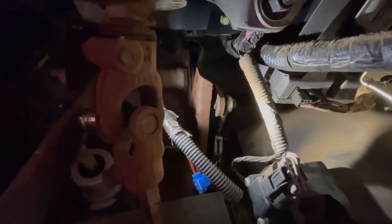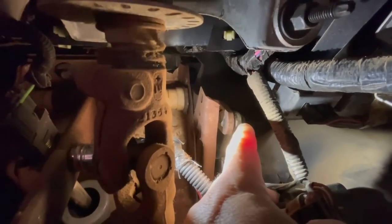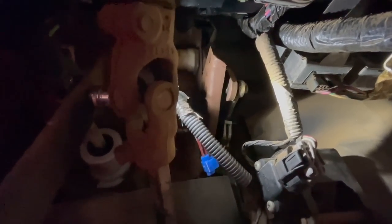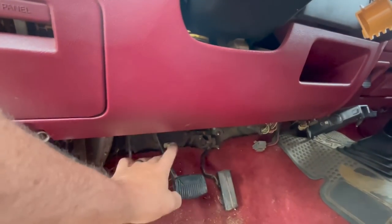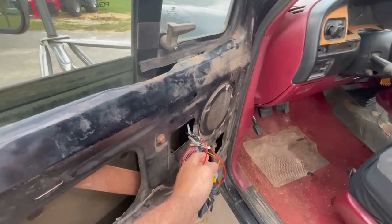That's the piece I think it is right here. See how it moves when I push the clutch in — see it moving, traveling? There's a bushing right here. They make a permanent fix for it — it's like a heim joint that you screw onto it. But that bushing just comes out and you can replace it with a three dollar bushing. If that doesn't work, I may look at the slave cylinder, but these are notorious for wearing out that bushing.